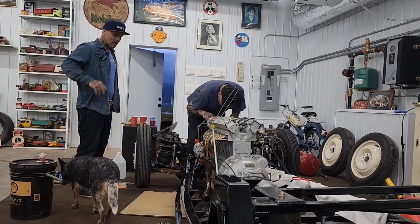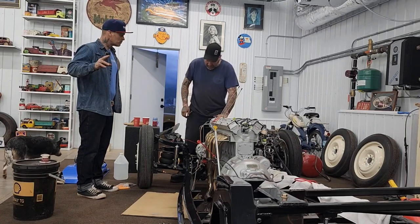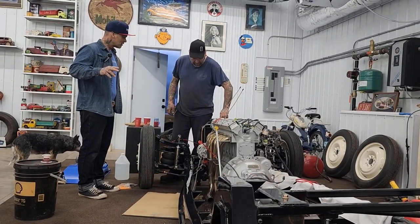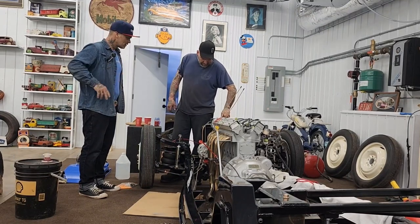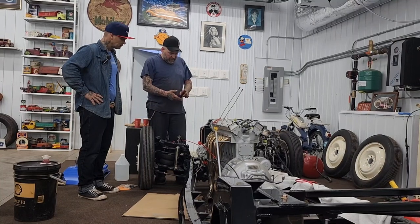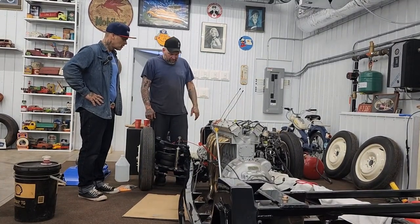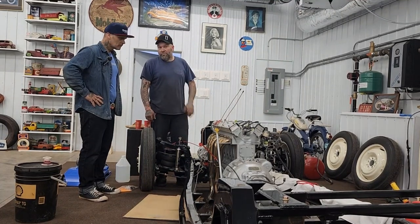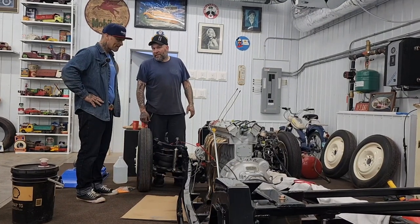So now we got to get the power steering lines. She built up pressure? We'll just take the pressure off so it doesn't keep anything on it. Just leave it loose for now. Awesome. So if we get a power steering line on it now, then we can get that circulating and then we can put the fan belt on it. Once the fan's on, then you'll be able to run it for longer. It'll stay cool then. And then you can play with it a little bit more and do all the carbs while it's running.